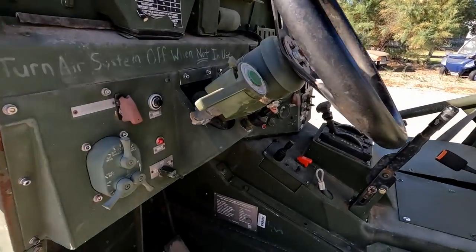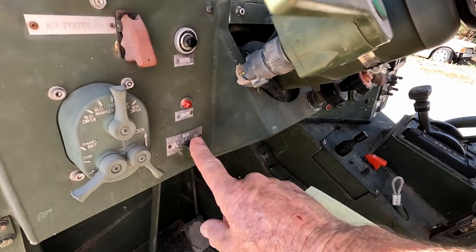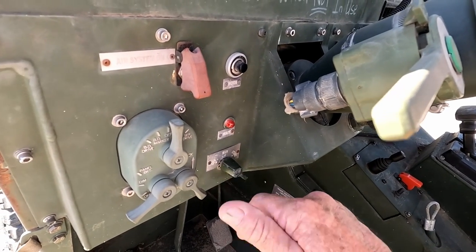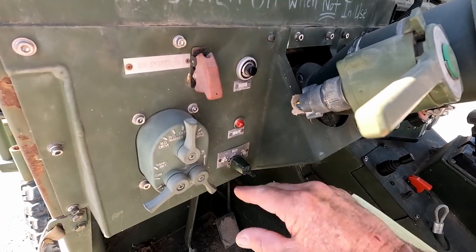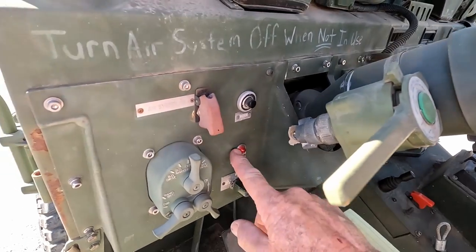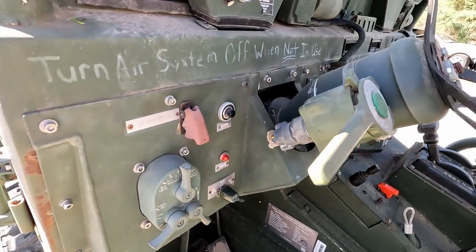We come to the cab. He didn't want a key switch, but this switch was messed up. The handle here was upside down, and the switch housing was just loose. So I tightened all that up, centered it where it belongs, so everything lines up. The wait light here for the glow plugs, I had to put in the light on that because it was just missing.